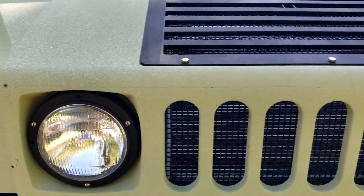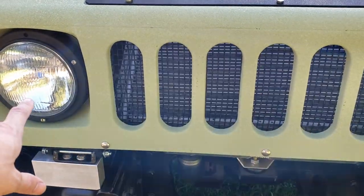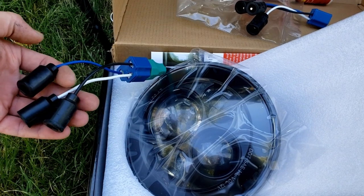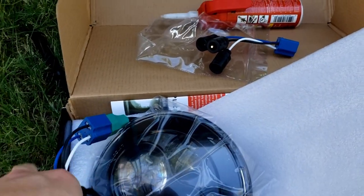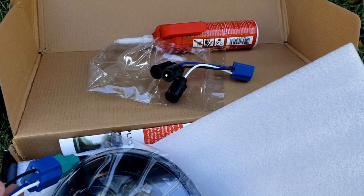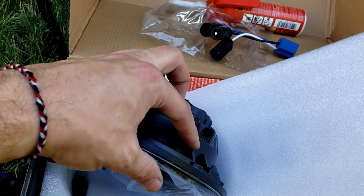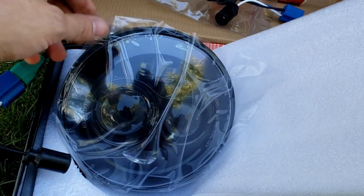Since we're fixing up so much stuff on this anyway, we're going to go ahead and replace the headlights. These were from the 24-volt system — they work fine for that — but if they were for 24 volt and we go to 12 volt, they're just really not going to be bright enough. So we're going with a new set. These are DOT SAE approved and I'm using little adapters to go from that style plug to what we have on the HMMWV. I don't remember which company I got these from but they look well made. They're not particularly made for the HMMWV so I was hoping we'd have clearance — I thought I might need to take off a fin or two to get it to fit.